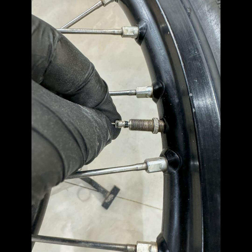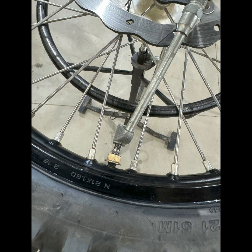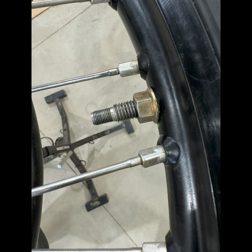If it still isn't sealed at this point, remove the valve core, loosen the rim lock nut, bounce and rotate the tire again, and reinstall and inflate everything as stated before. You may need to do this 2 or 3 times if it is really sticking somewhere in the tire.